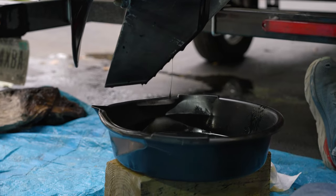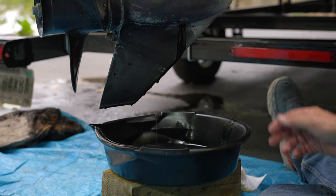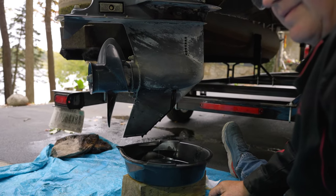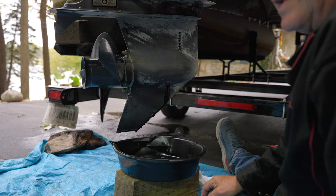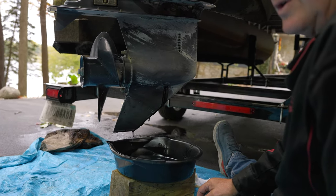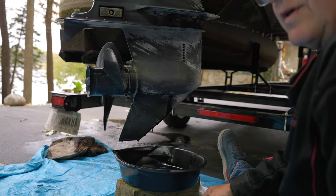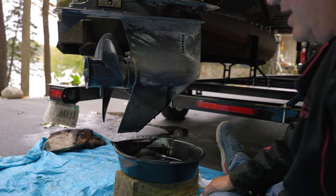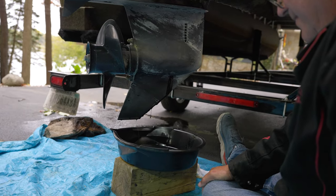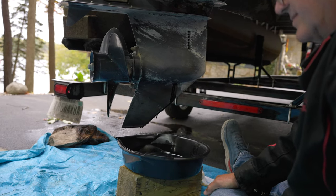EFI. I'm going to do my boat. So you're just going to change the oil on it? What else are you going to do to it? We're going to run antifreeze through the engine block. That's the biggest thing. And through the ballast too. The hoses down there along the bottom. You've got to get those. That's where it's tricky. Now, the other option: fog the engine, stabilizer in the fuel. I'm going to get a big old tarp to put over the lift.